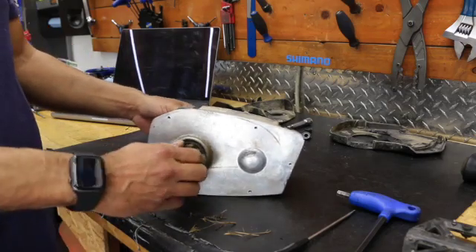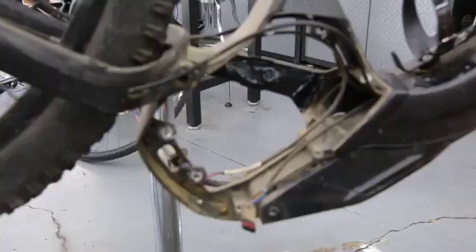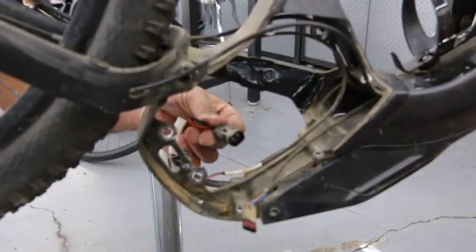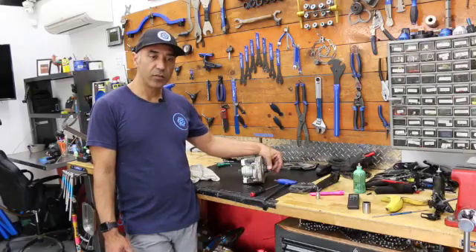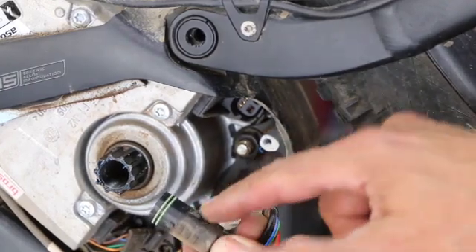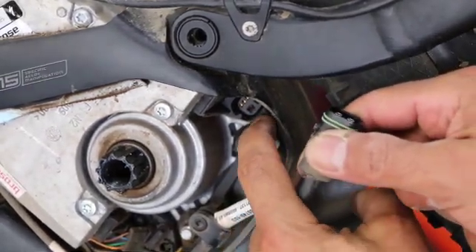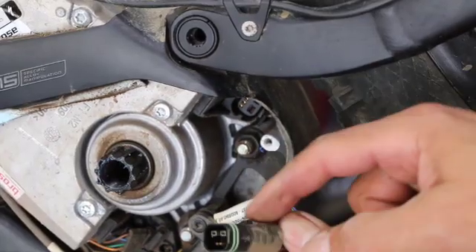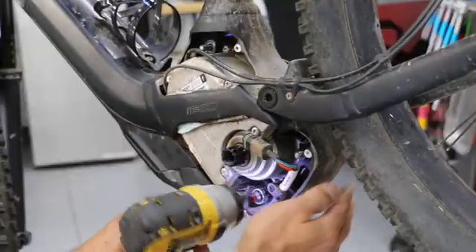It's awesome how their business morphed like that. This is a customer's bike. The symptoms are intermittent slipping — trying to get into turbo fast mode, it'll engage sometimes or it won't. It still pedals, which tells me the belt is still working — the belt's not worn or broken.